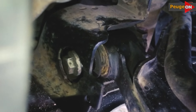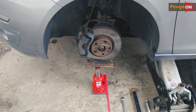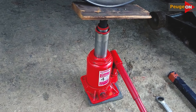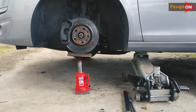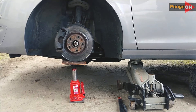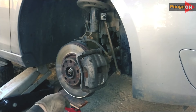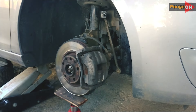Regarding the sequence of attaching the lever — the final part — when you've torqued everything by hand, it's important that everything is tightened with the car standing on its wheels. But how do you do it without a pit? I solved this by getting a second jack and jacking up the wheel until it stood upright as if the car was simply standing on the ground. If we first tighten everything and then lower the car, the silent block will always be under load even when the car is just parked. As a result, the silent block moves less, roughly speaking.